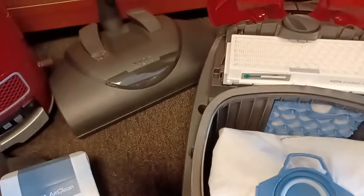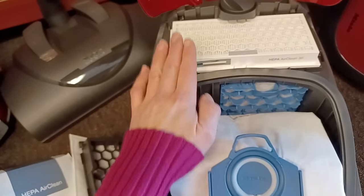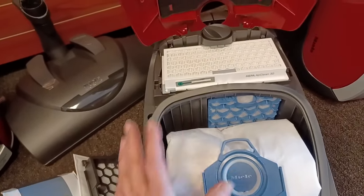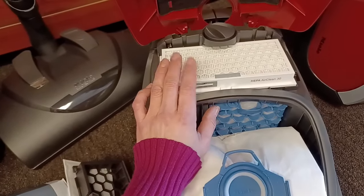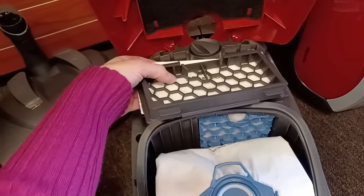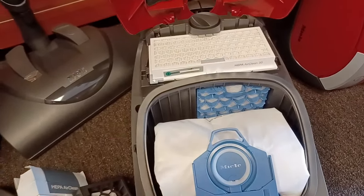Why might you use that cage? Say you have construction in the house. Lots and lots of sheetrock dust will overwhelm the system — you'll use bags quickly and some will pass through into the HEPA filter, filling it up prematurely. You really want to use a shop vac for all that, but when doing your final cleanup, yes, use your Miele. I just recommend not wasting a HEPA filter on that. Instead, take the HEPA out, put the basic system in for the remediation, then remove it all again, put in fresh bags and filter, and put your HEPA back in. That way you don't waste your HEPA filter.